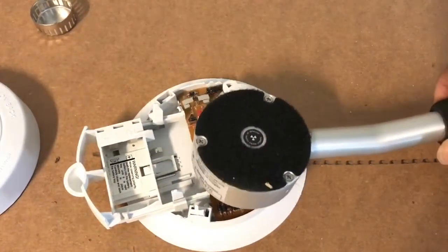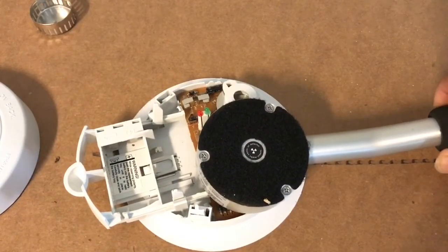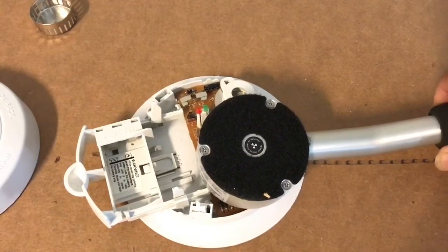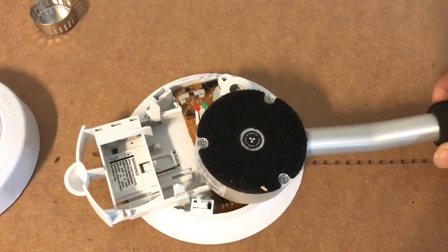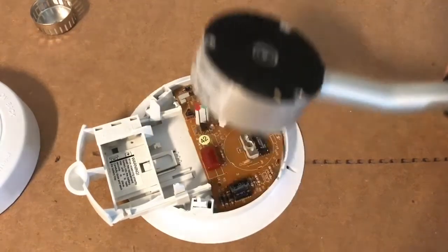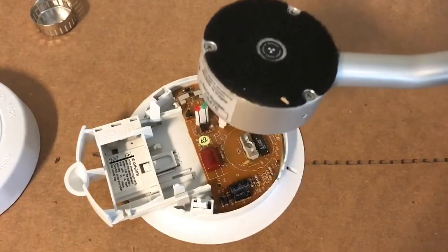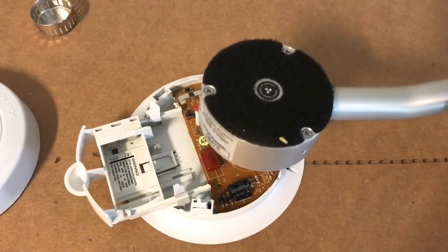This is quite a bit actually. The closer I get, the more I get. The reason is that the alpha particles have a very short range in air, and this detector can pick up alpha particles. The problem is when you get too far away the alpha particles can't reach it — the beta and gamma can, which is what I'm hearing right now.